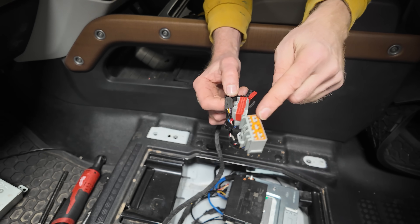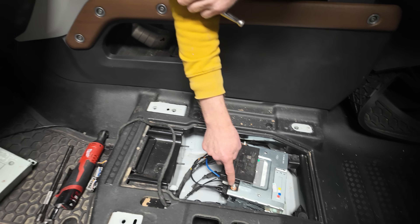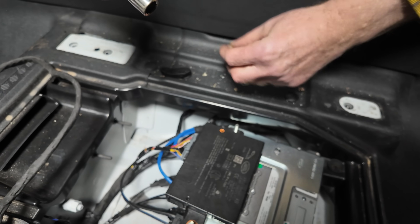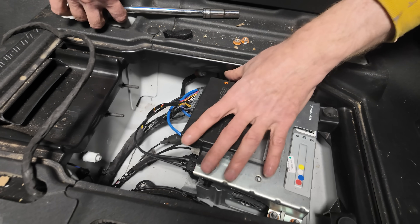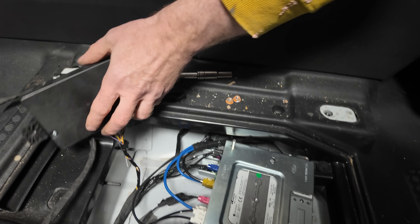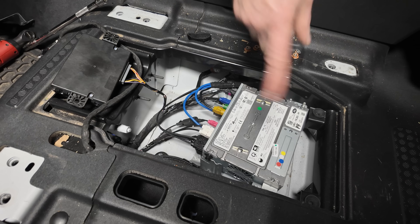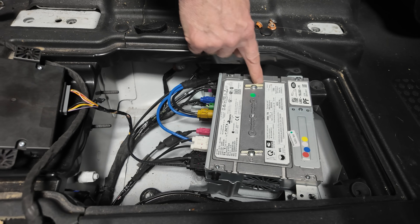Here is the beast in question. Sat piggyback on top is the KVM - the keyless vehicle module - that's what your keys are coded to. Underneath we have this module here - this is the PIVI, I think they call it an ICU or infotainment control unit. We're going to take this off now. So let's take these two bolts off first. They've got those nice little flanged nuts - handy. That then comes off. Now there's a cage that goes over this, so let me buzz off all four bolts. Now that cage is removed and we can start to lift that out.